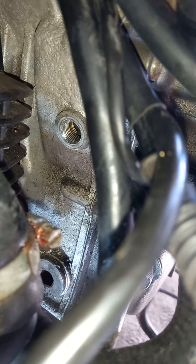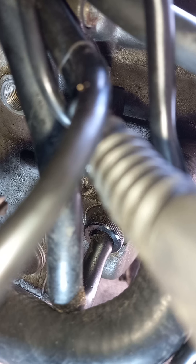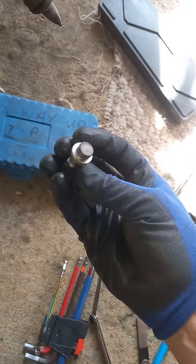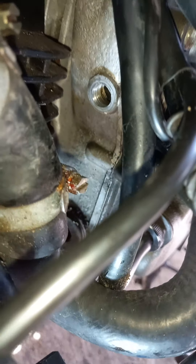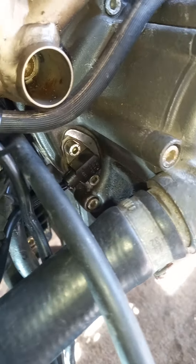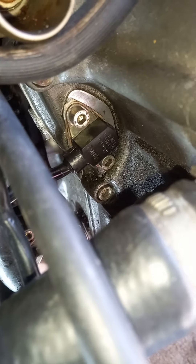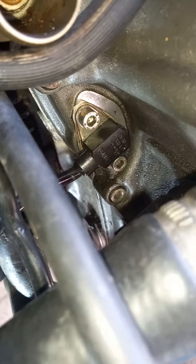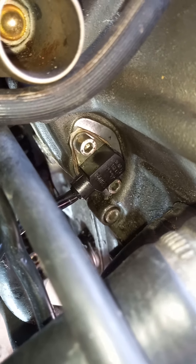Anyway, that's how you check it. You can see the actual measurement in the manual for the ST2 1998. Basically there's a little plug which is very, very tight — seems to be done up with quite a torque. That's the little plug that sits in that gap, which obviously measures the distance for the crank sensor. The crank sensor is actually sensing off one of the drives off the crankshaft, and that sends a signal to the ECU, which sends a signal to get everything right for the pulses on the injectors.